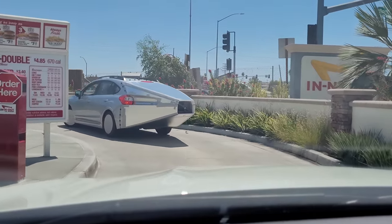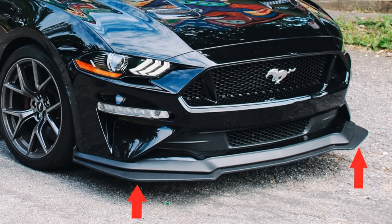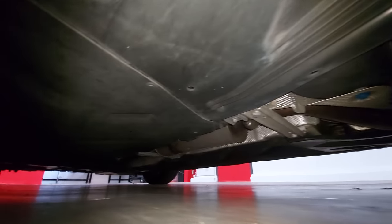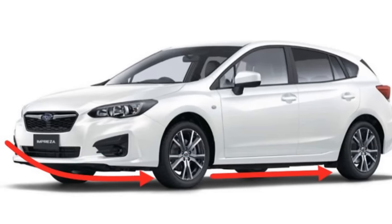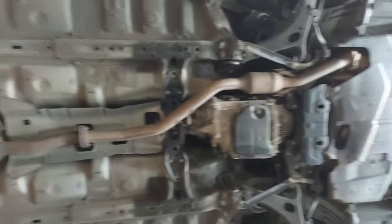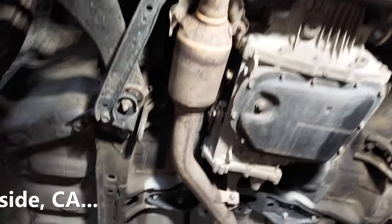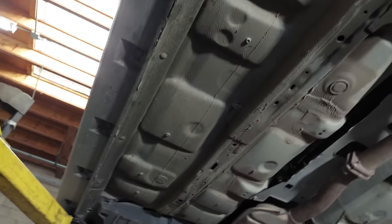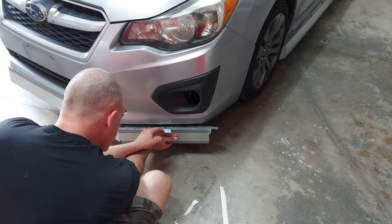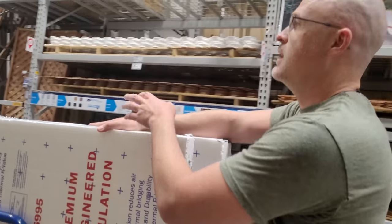One problem I didn't appreciate in creating Mark 1 was the drag created by the underbody of the car. There are two main solutions: make the air go around, or make the bottom of the car as smooth as the rest of the vehicle. I really wanted to do an A-B test between those two approaches. A local shop let me put the car up on their lift. After inspecting the underbody, an effective aerodynamic solution was out of reach, so the A-B test would be making the air go around versus leaving it alone. Then it was back to Lowe's for materials.